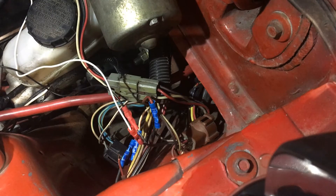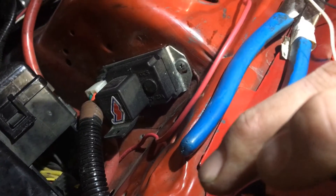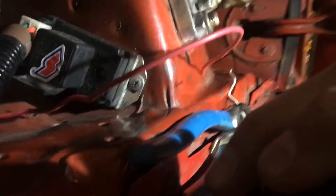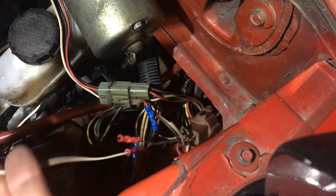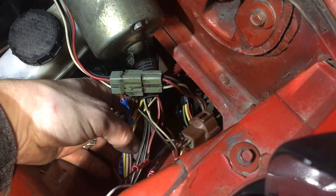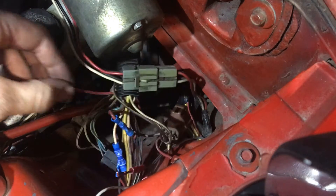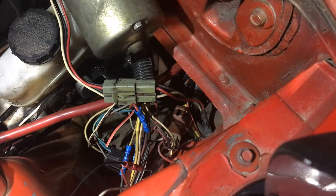I already spliced on some smaller wires - that's coming from my fan relay which is mounted right there. The adjustability is right in here, so the cap comes off and you can see there's a little rheostat inside. You turn that to adjust when you want your fan to come on. For the ground side, I'll hook the ground in here where I've got a couple of grounds - I'm pretty sure all three of those are grounds but I'll test those out as well, and then connect the positive in there and add this other wire into the splice.